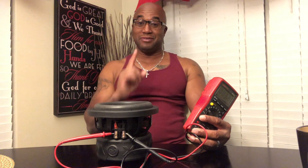So if the sub has been damaged and it's a D4, it's not going to read two ohms — it's not going to read less than what it's rated. It's going to read higher than it's rated if it's been damaged. So if someone says it's a D4 sub, but when you hook it up the ohm load is 2.5 — no, that means it's a D2 sub, not a D4. When you set it up to the multimeter, walked away, let it sit three to five minutes, and it came back at 2.5 or 2.6 — that means it's a dual two.